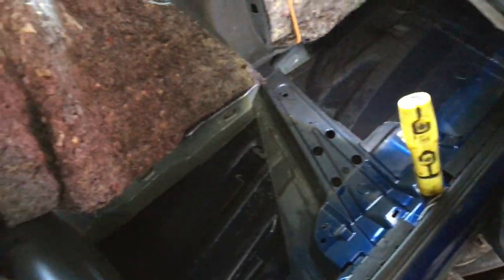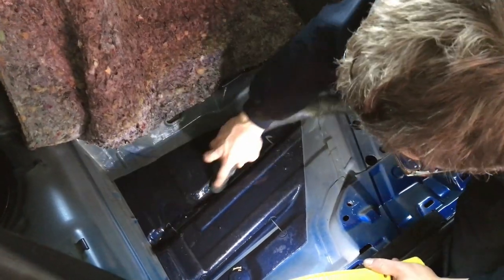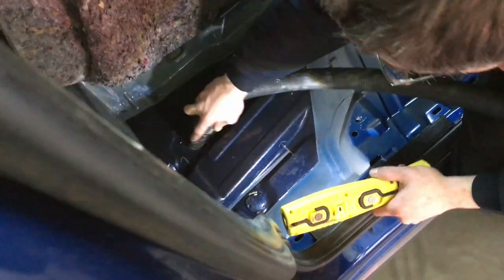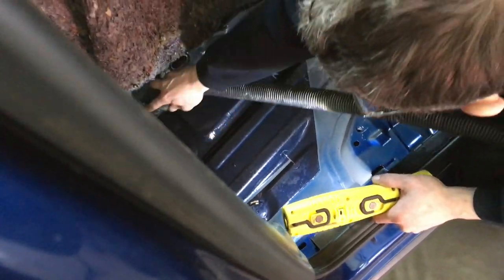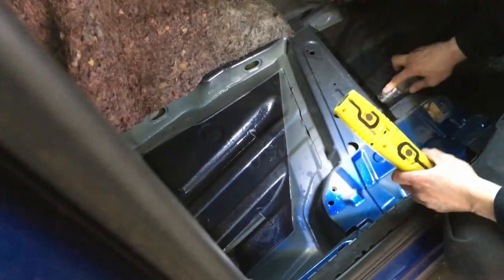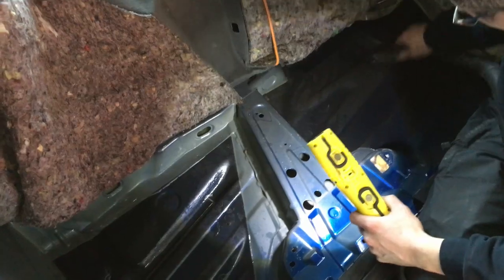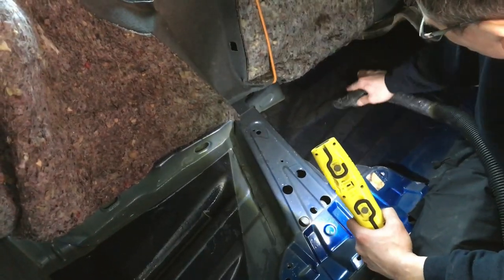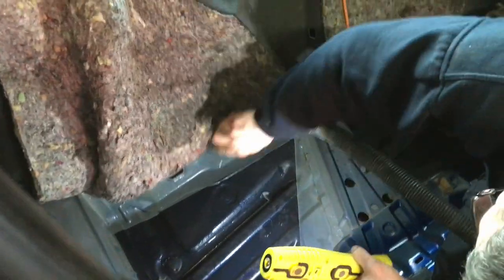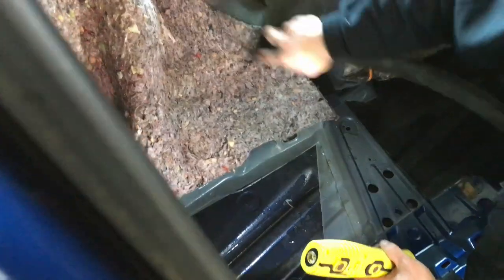James is going to get the suction machine and pull out the bulk of the water first, which is fairly easy to do. You've got to have a wet vac for this — we've got a commercial one with two engines in it. It pulls the water out from the foam or felt, depending on what car. Then in our instance, we've got a three-phase blowing machine, so we're going to put the blower in there and suck it out.